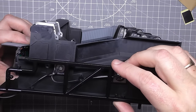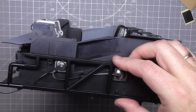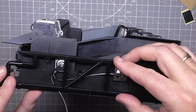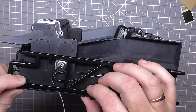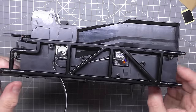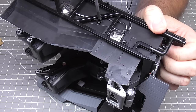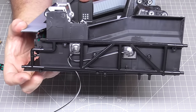This is where the frame is going to go — the frame is actually going to pin all of this into place here. I do want this cable to be coming out of the little notch in the base. It's going to go on just like this. There are some pins at the bottom which are going to help to align it. I'm going to be holding that in with three EP screws. When screwing these in, just make sure none of the wires are pinched. And there we go — that's in nice and tight, and that's all there is to do in that stage.